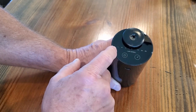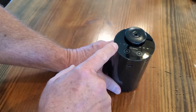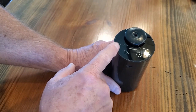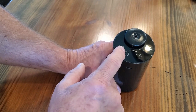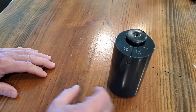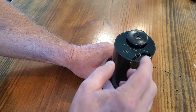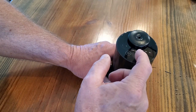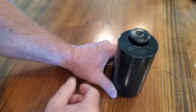The low, medium, and high settings determine the time the unit actually runs. On low it'll run five seconds, on medium it will run 15 seconds, and on high it will run 30 seconds — puffing out the oil mist for that duration. Then the one hour, two hour, or three hour setting is the interval in which it runs.